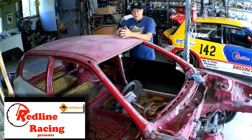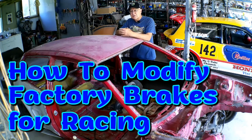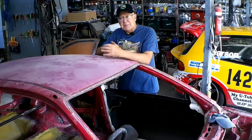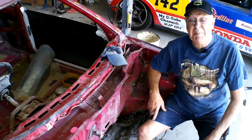If you're building a car to race on the track or on the gravel, you're going to have to make some changes to the braking system. Car manufacturers primarily balance their braking systems by the size of the components they put into the cars. Then you and I come along and totally change the weight balance by stripping and lightening it, fitting new components like larger discs, bigger calipers, even changing the master cylinders. Swap in a bigger motor and you've changed the weight balance even more. Heavy braking at high speeds, whether on the tar or on the dirt, demands much more of a braking system — factory systems were never designed to handle these extreme demands.